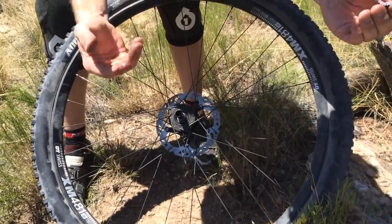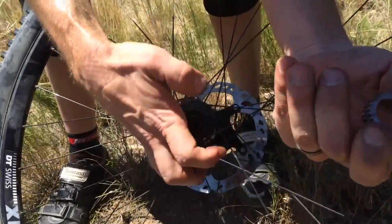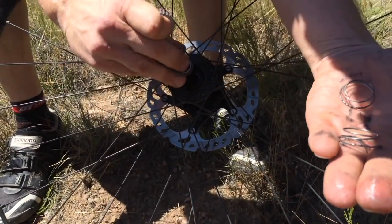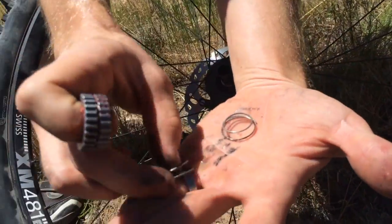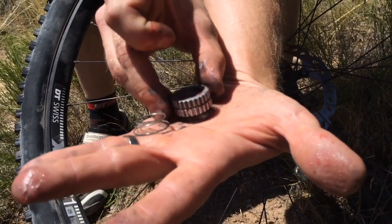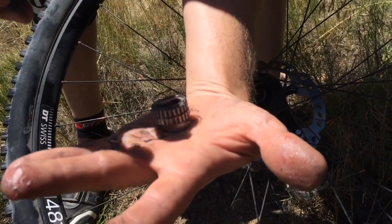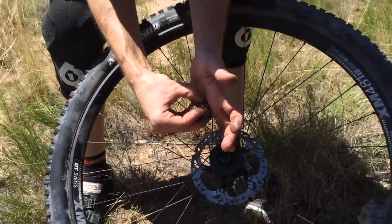Real quick I just cleaned and greased them, but I'll pull the rest of the hub apart so everyone can see. We have two ratchets, two springs, and a spacer sleeve. Go ahead and put that spacer sleeve on there — it just goes in, doesn't matter either way. The springs do have a taper to them, so we want that smaller coil of the taper to be touching the ratchet. If you picture quick-release springs, we want that same aspect — that smaller taper pointing towards the center on both sides of those ratchets.